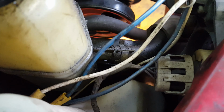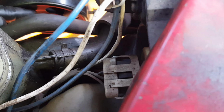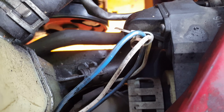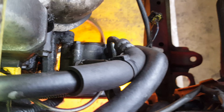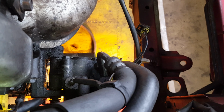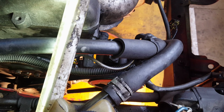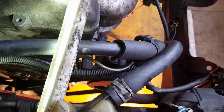Now, one thing I want to do before, let's see if you can see down in there. There are slots in the pulley wheel. Let's see if I can get my finger down in there. There we go. That slot and another one opposite. Now, while the belt is still loose, I want to rotate that slot so that it is centered over top of this nut, that otherwise is hidden behind it. So I'm going to do that before I tighten anything. Otherwise, I'd have to loosen it all and rotate the whole engine. So either way, we'll do it right the first time.